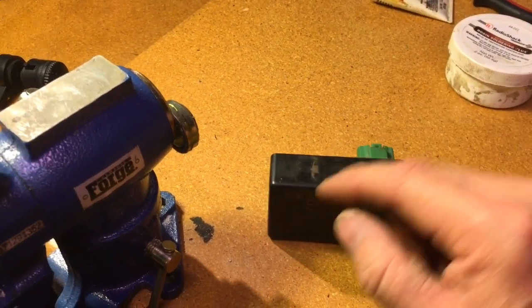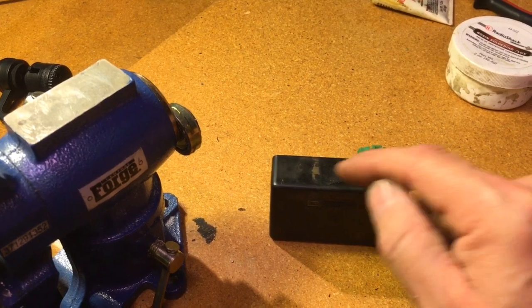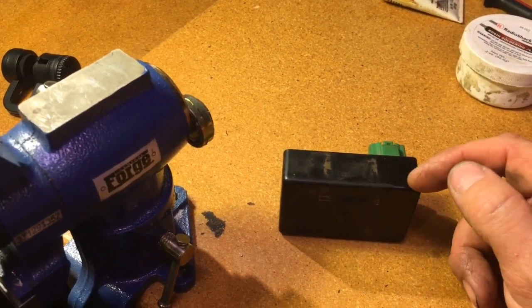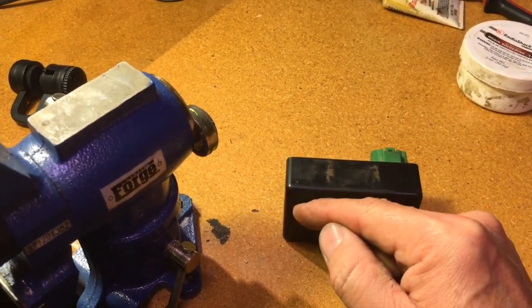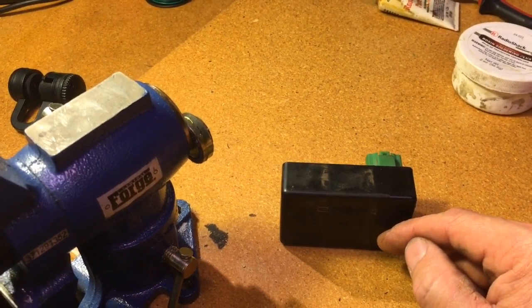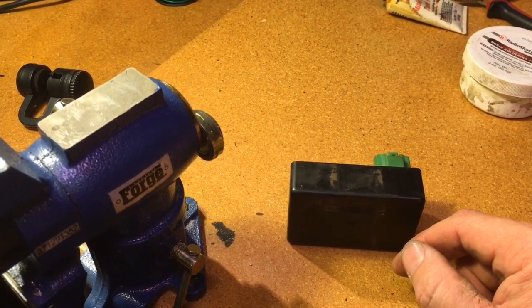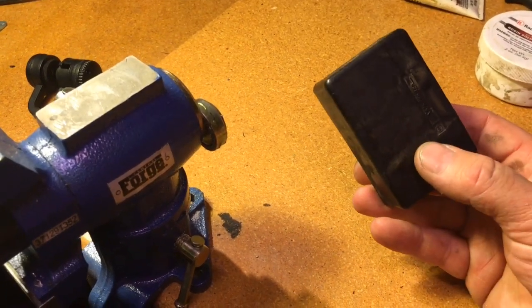I like the way the hacksaw feels to the hand — I can tell if I'm getting too close to the end of the board. The main board is sitting about a centimeter down from here, so I'll be able to see the exposed backside of the board. When I see that and look at it closely, hopefully I'll be able to find where some of the cracks are that are preventing the CDI from working.